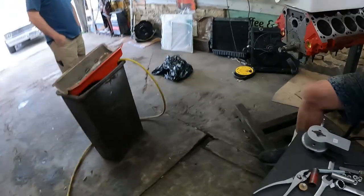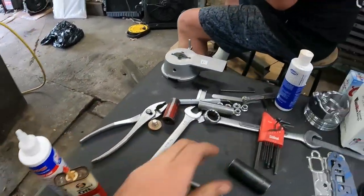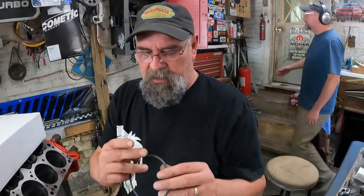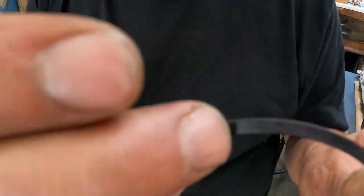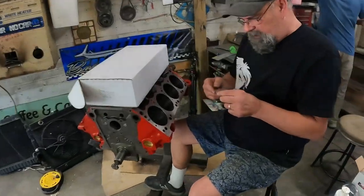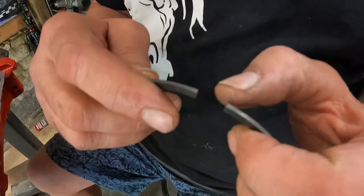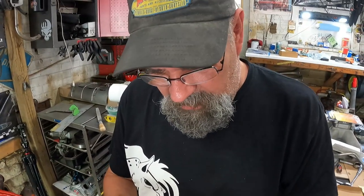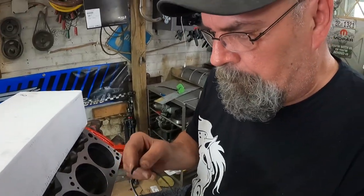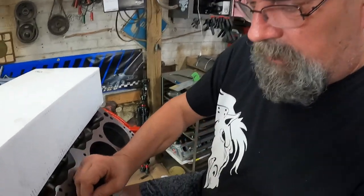Frickin' magnet on a stick, picking everything up. Yeah, when you do these, you want to make sure that before you stick them in the piston or whatever, you don't feel that sharp edge here. So we'll hit it with a stone if we got a stone. There's that big stone. But you don't want to actually really chamfer it, you just want to break it, deburr it. Desharpen it, because you don't want this going up and down, scoring your cylinder wall. Right, exactly. Potentially.